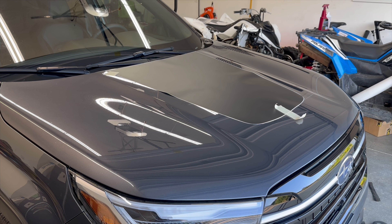Once you have everything clean, you can align the hood stripe side to side. There's about a half inch gap — maybe three-eighths — between where the hood stripe stops and where the hood stops. Optionally, you could run it a little past it and roll it over that edge, whichever you like better visually. On the darker colors you're not going to notice as much, but on white and brighter silver you will notice that line in the back.